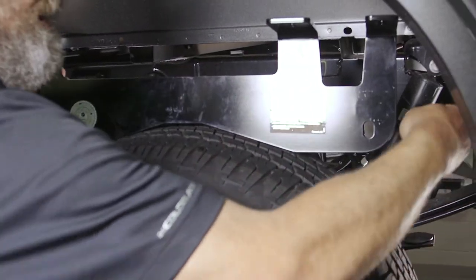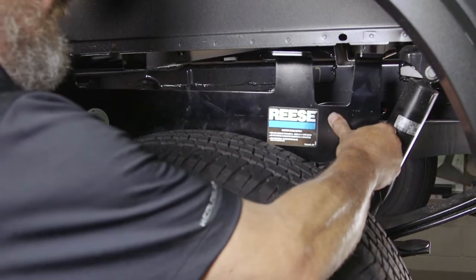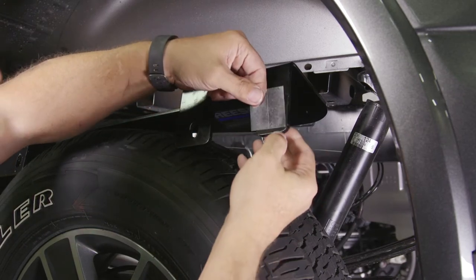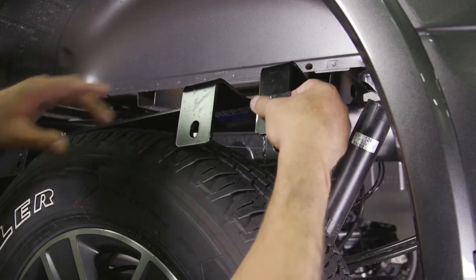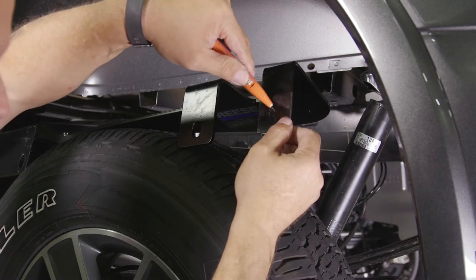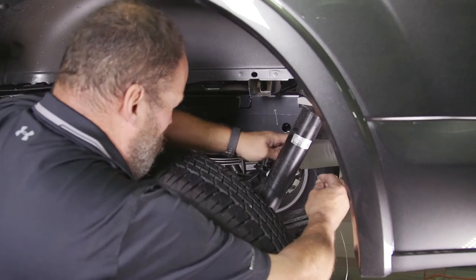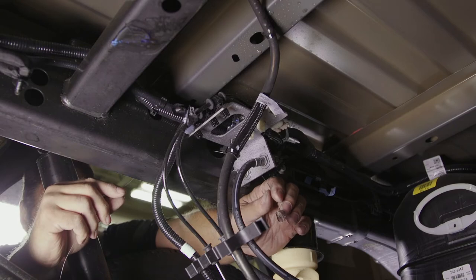After drilling the pilot holes, loosely install the frame brackets to the frame of the truck to ensure that the pilot holes of the rails align with the bolt holes of the frame brackets. Before installing, place the provided galvanic isolator squares over the flat steel surface of the frame brackets that will contact the aluminum truck bed. Use a knife to slit the isolators covering the holes for the mounting bolts to allow for bolt access. Working in the rear wheel well, insert the coiled end of the provided pull wire through the truck's rear mounting hole and out the back of the provided access hole on the inside of the frame.